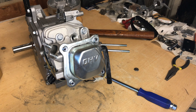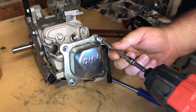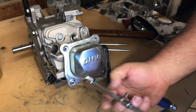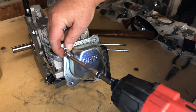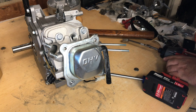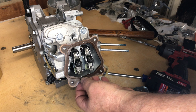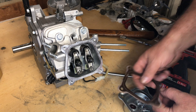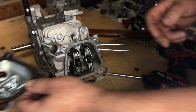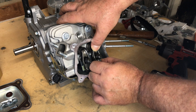I'm kind of anxious to see if this one has the same cylinder head as the Killer Tiller engine. I was fully expecting a 25 millimeter intake and 24 millimeter exhaust. As it turns out this one has the same — a 27 millimeter intake and a 25 millimeter exhaust. I was just floored. That's another plus for these $49.95 engines.